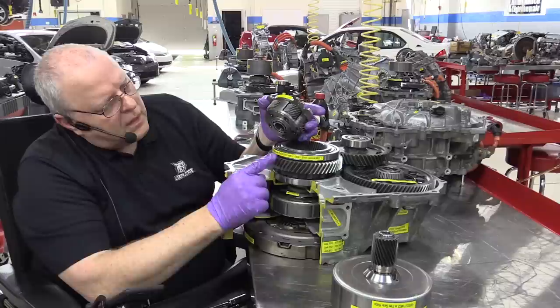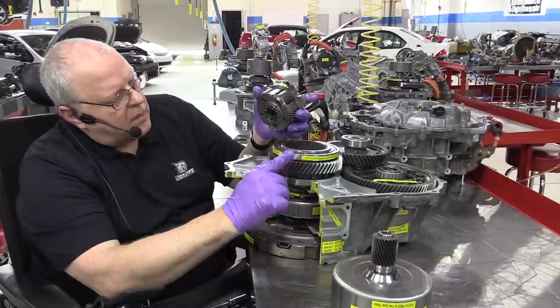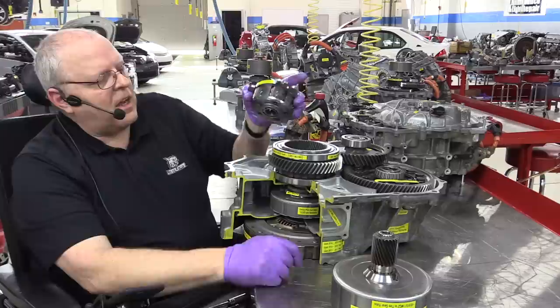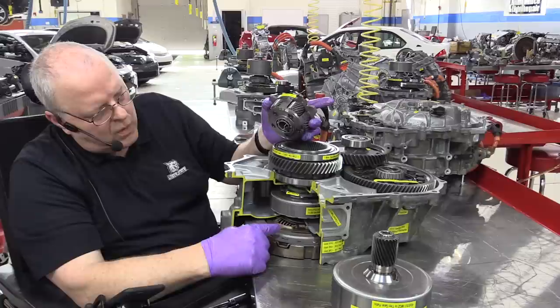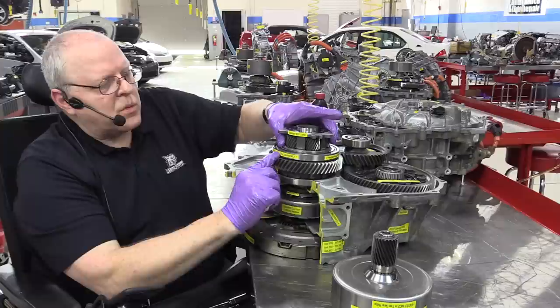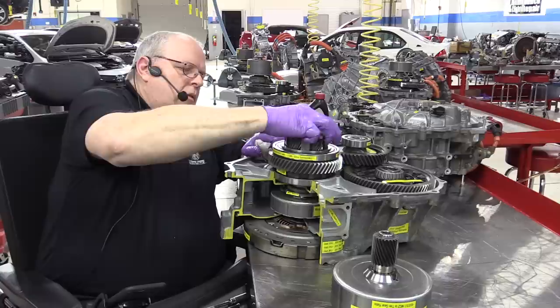By the way, the bottom planetary gear set here, the power split device, the sun gear has 30 teeth, the planet gears are 23, and the ring gear is 78, if you want to do the math and come up with a gear ratio of 2.6 to 1 from MG1 to the ring gear, and then a gear ratio of 2.636 to 1 from MG2 to the drive gear here on the...